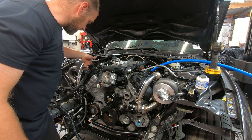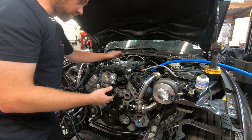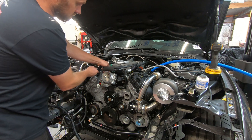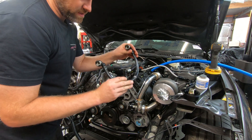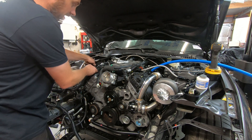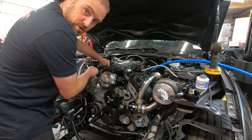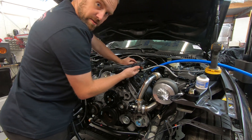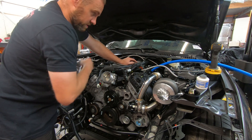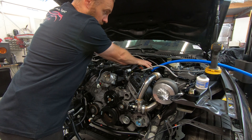I don't have an oil cap option on this particular vehicle — it's covered up. I can take it off to fill the oil, but I can't get anything on there to actually pressurize from. This vehicle has very large PCV system hoses. You can see the PCV system hose and where the actual PCV valve is, but that's a restricted orifice — you don't want to go to the PCV valve. What you want instead is the inlet for clean air going into the engine, which is on the other valve cover. It's a cross-flow system, and this port here is full-flowing for the size of the port.